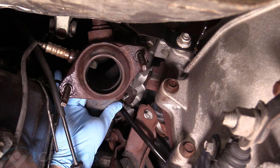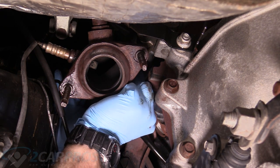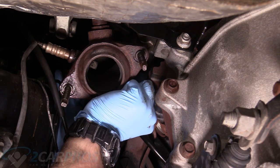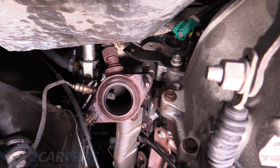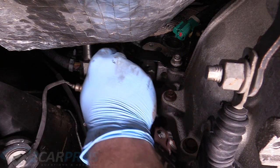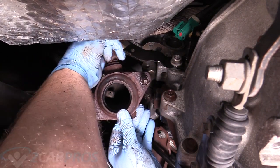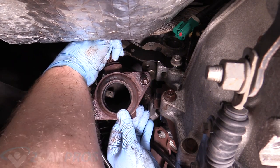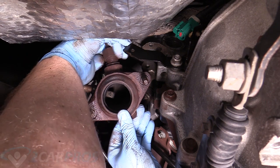And then, while we're in this position, go ahead and replace at least one of these nuts. I'm gonna try to do two here. All right, so we're gonna leave the manifold a little bit loose here. I haven't even put in all of the nuts yet because we need this clean air tube to be reattached. Now, if you put all the bolts in and you have no play or leeway, this will be insanely difficult for you. So it's easier to do it this way.